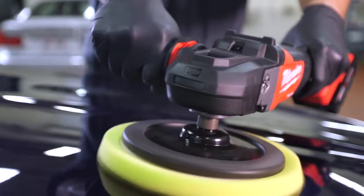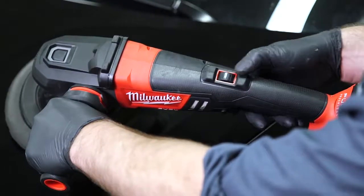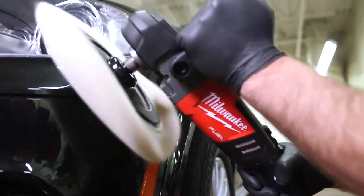It's very important to have control over the polisher. When you're buffing at high RPMs, if you leave it on an area too long, you can burn paint or damage the car, which costs extra money. So if you have something that's easy to use, you can avoid that.